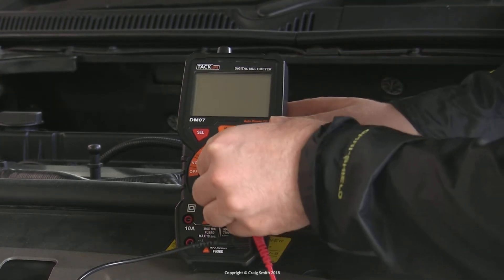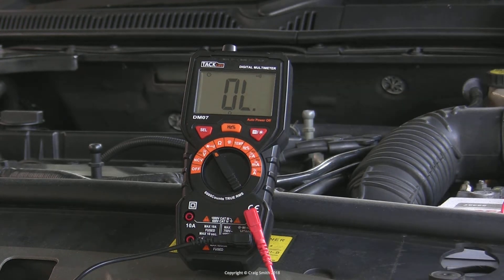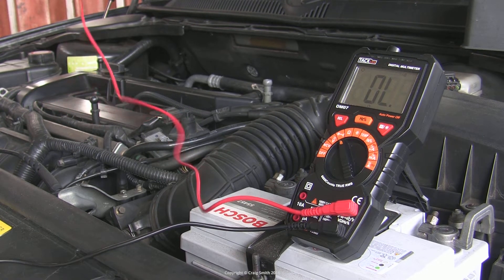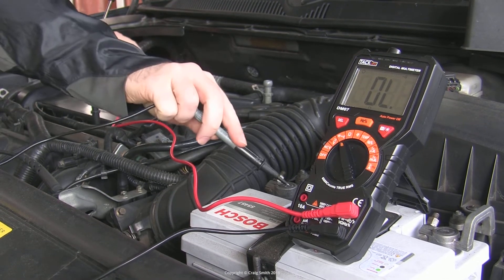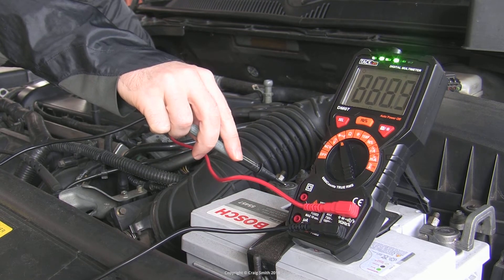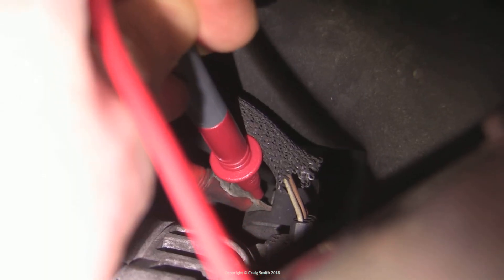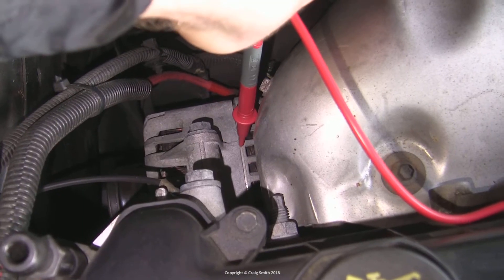You would start with testing basic continuity along the direct circuitry to check the wiring and any fusible links in place. Use the resistance setting on your multimeter — a beep test is fine, or you can look for a low resistance measurement. You can then test the circuits: that's the battery positive to the alternator positive, which will usually be the red cable coming off the alternator, and the battery negative to the alternator body.